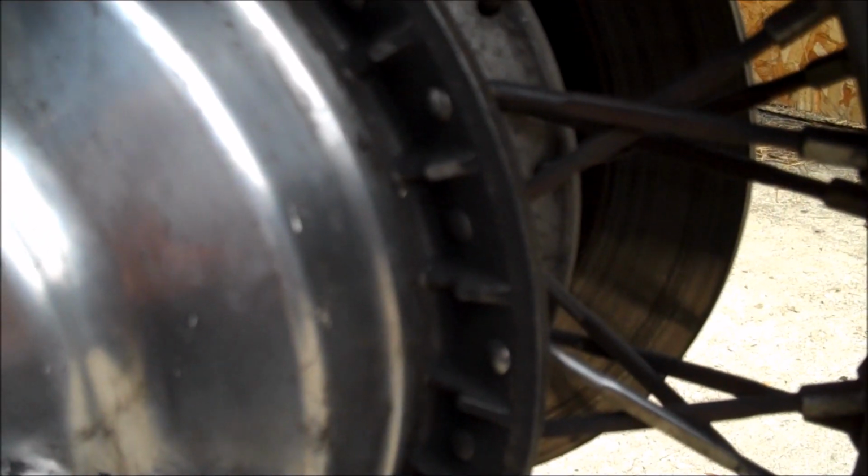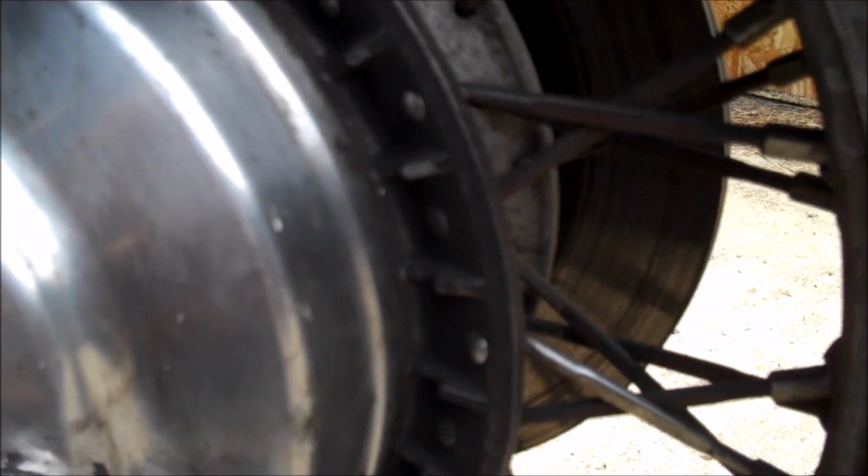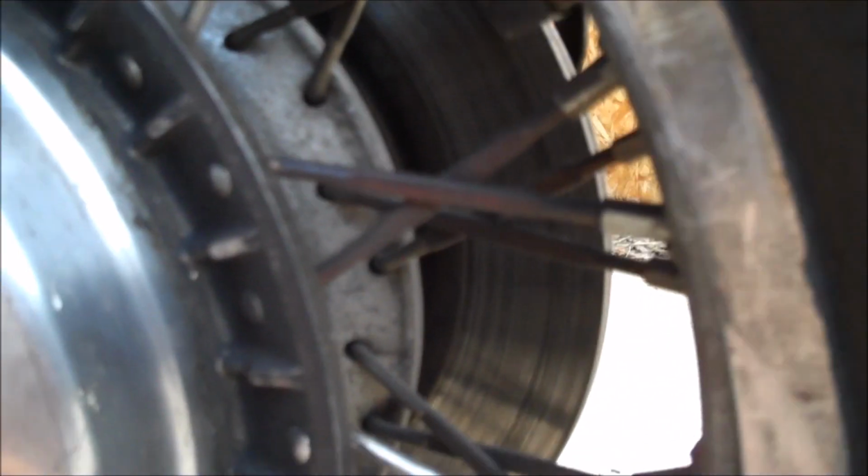These shaft drives should not leak into the hub. They should be self-contained, but if they have a bad seal, then they might leak inside where the splines meet the hub. And this isn't a controlled seal right here, right where it meets in with the hub. It's not like there's a gasket there because the wheel is always rotating. So then you'll have a little bit of dribble right down there. Not a big deal. You just go in there, replace your seal. Similarly, right here where it meets up with the drive shaft housing, sometimes you'll get some leaks.